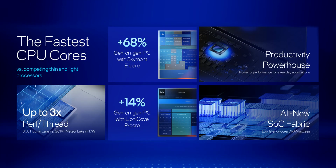Intel still addressed overall performance by adding a huge shot of adrenaline to their efficiency cores, while also boosting the P core's IPC versus Meteor Lake. There's also a ton of changes in the backend that improve latencies and memory access.